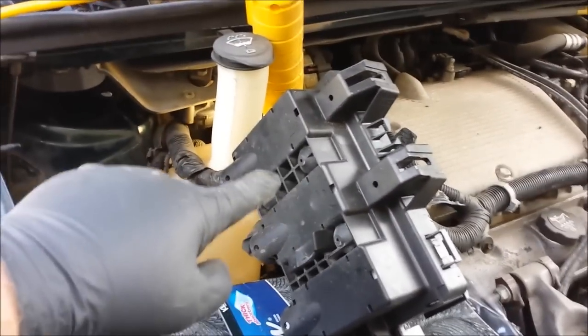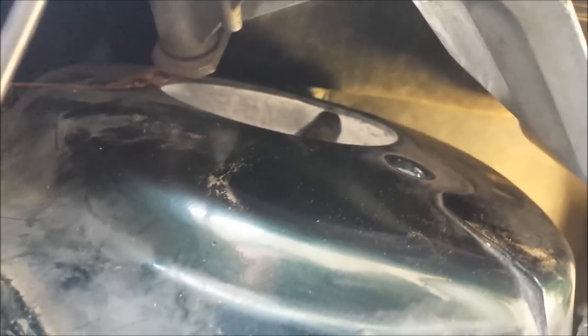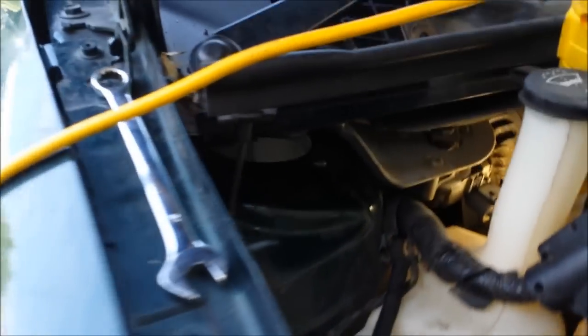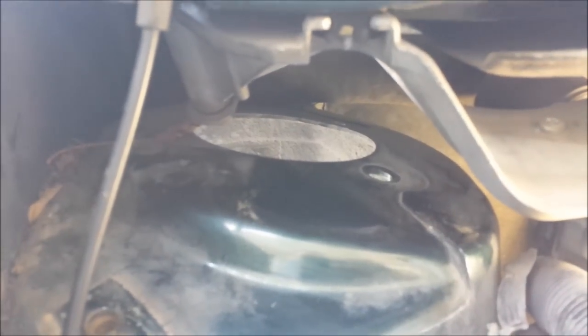These three were a little bit harder to get to — this box came loose and I just stood it up out of the way. The one in the front was fairly easy and the one on the left is easy, but that one back there is a tough one to get to — right there where my finger is. Once it came out, the rest of the strut just kind of dropped out; it wasn't so bad. When we put the new one in, we're going to try to put that back one on the right in first and hopefully just get it started enough that the ratcheting wrench can grab hold of it and tighten it up.